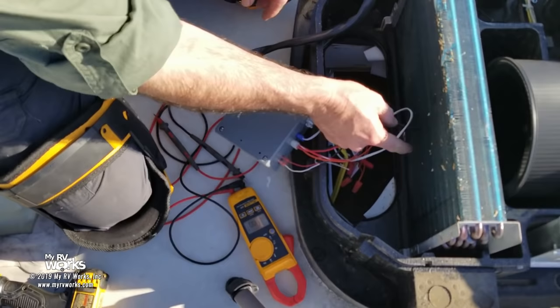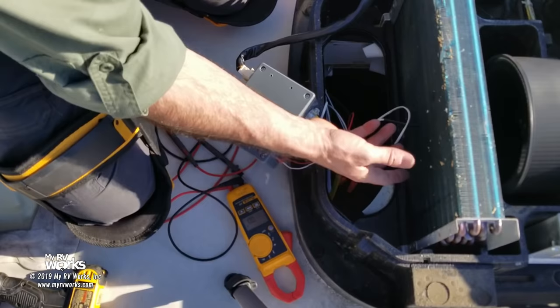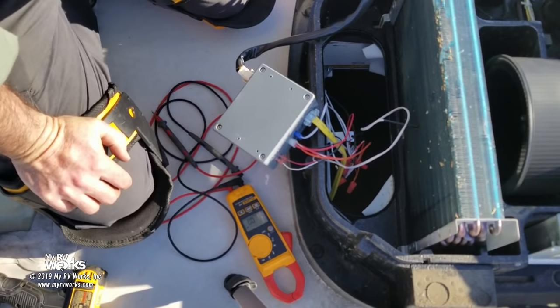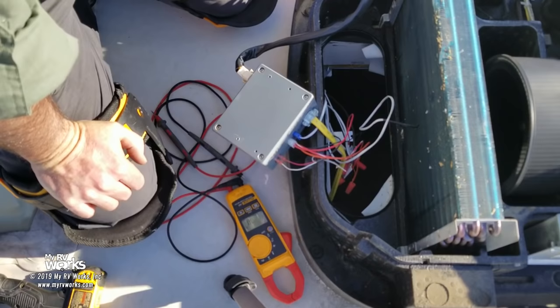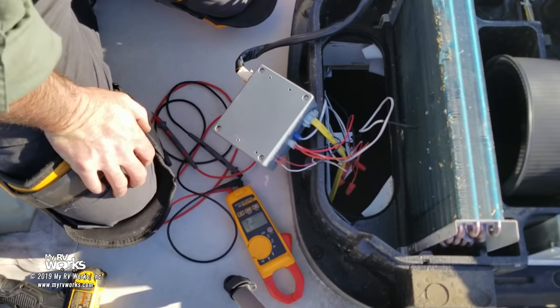Of course we have our AC power. This blue wire here goes to the freeze sensor — can you see that freeze sensor? It's stuck in the fins. This is going to get very cold. If the freeze sensor fails, or it's not plugged in, this thing will freeze up like a block of ice — I've got pictures to show you. The freeze sensor needs to be in the fins, reading the temperature of the fins. The customer has a Dometic SZ1 thermostat, and there is a diagnostics mode where you can actually read the temperature of this probe. At this point, I'm going to give the top side a clean bill of health.